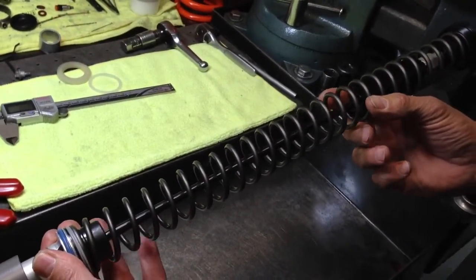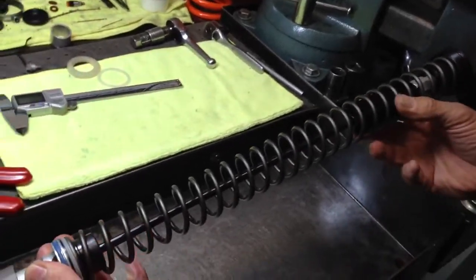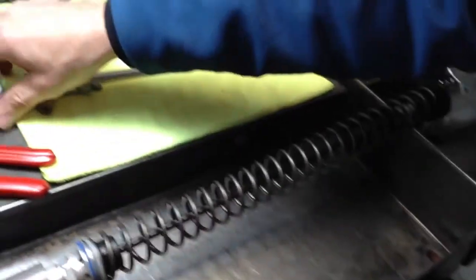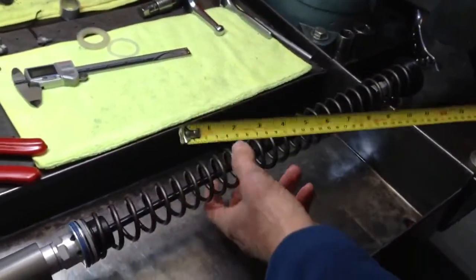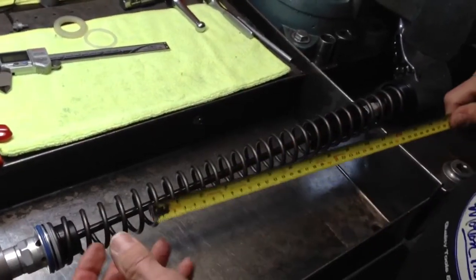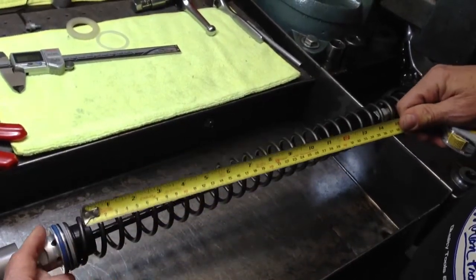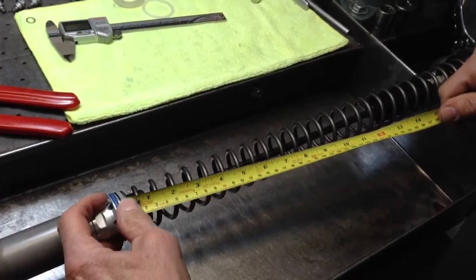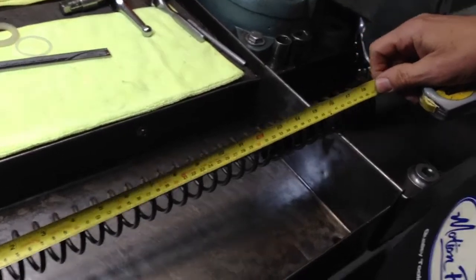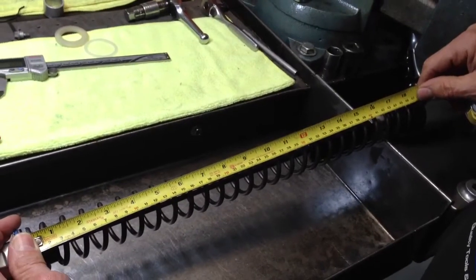You've got to make a judgment call here — I'm going to call that good right there. Then you measure, but you can't measure from one end of the spring to the other because the spring is up inside the cap. So you just use any reference points. I'm going to use this groove where the O-ring is — that's where this blue O-ring is. I'll put my tape measure in there and slide it into that slot, measuring to the bottom of the cap. You can measure to the top of the cap or whatever reference point you want. So it's 466 on this.